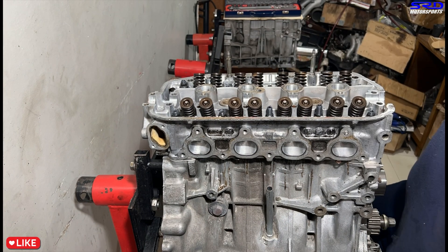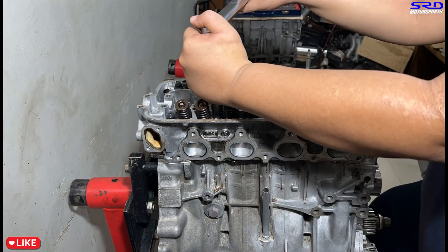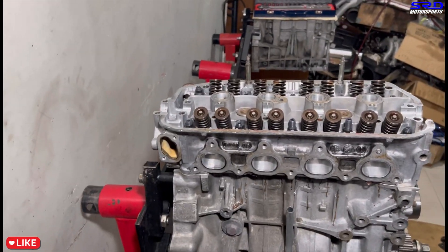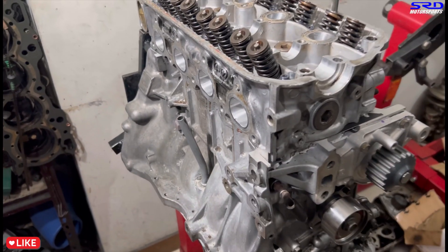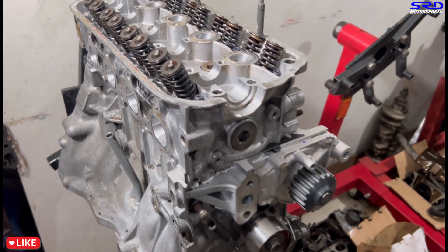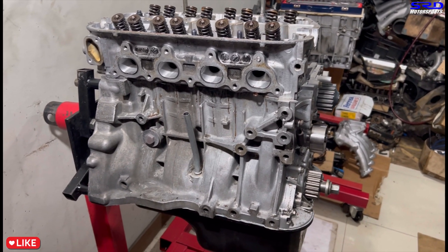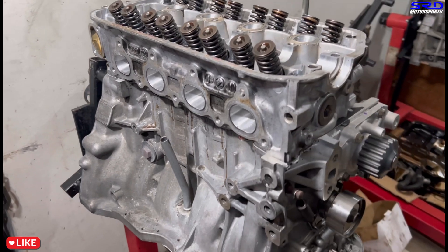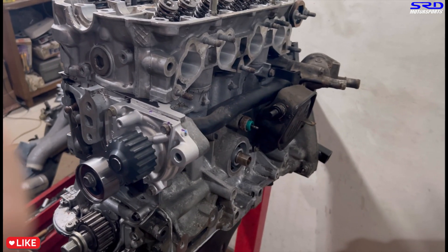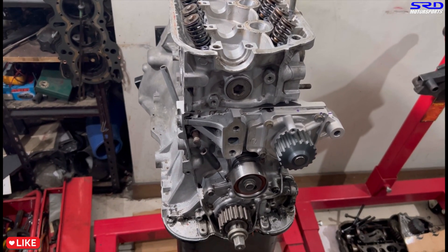We're going to time-lapse the rest because it's a lot heavier work - you can probably hear me breathing harder. My colleague will complete the rest. The engine is now all sealed up and complete with the head torqued and the bottom end finished. This stock D16A6 is going to surprise a lot of people - the owner plans to use it for autocross occasionally and some track use, so it's going to be fun and reliable.